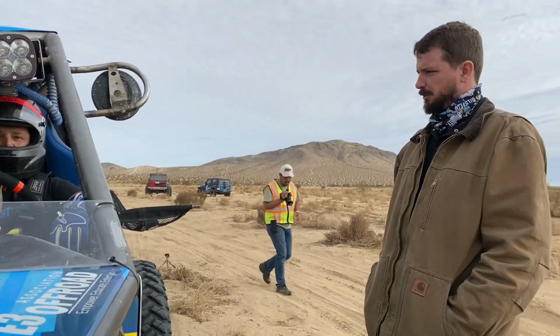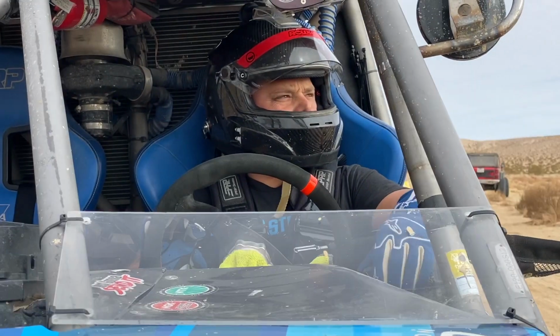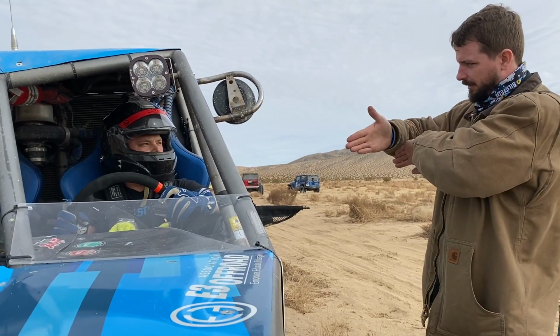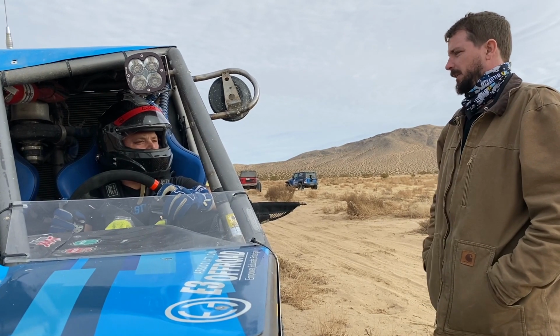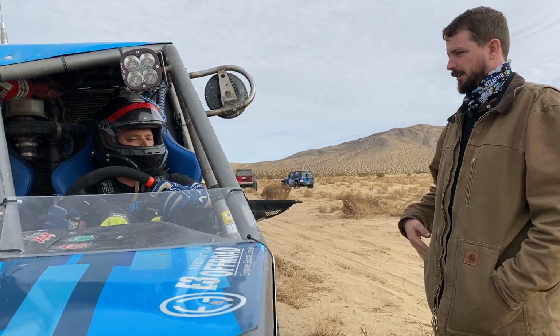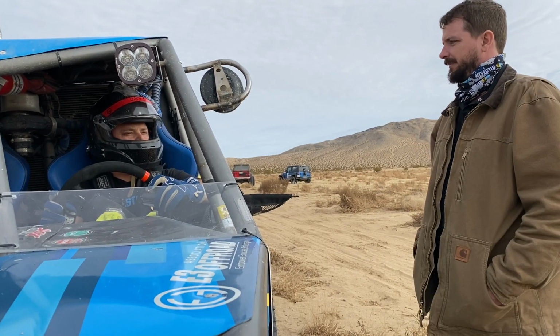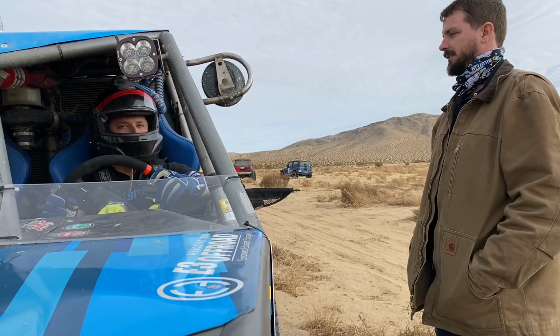Had any issues when you were doing the lap with the front bottoming out too hard or anything like that? I don't think so. I don't think I felt it. Does it look like it's packing? No, I think if we add a little bit of compression, it would stay closer to the ground. We can try it, and if it doesn't work, then we can take it back out. Because the car's staying level, but the wheels are coming up off the ground. So if we just slowed them down a little bit, they might stay in contact with the ground a little more often.